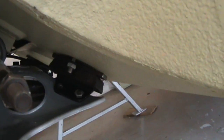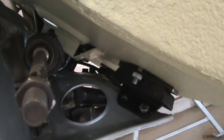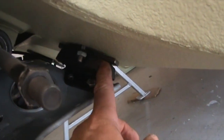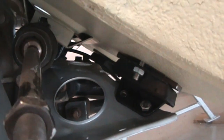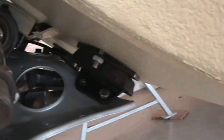To hopefully overcome the clearance issue between the rack and the differential, just where the subframe mount meets the floor I've put a little packer in - just as a temporary measure to try something. I think it's about four millimetres. What that does is open up the gap by lowering the rear of the subframe down slightly. I've gone from a very tight gap to something that's probably just about acceptable. So what I'll do is make some packers about five millimetres thick in aluminium, the same shape as the mount, and they'll be sandwiched between the floor and the subframe mount to drop it just slightly at the back.